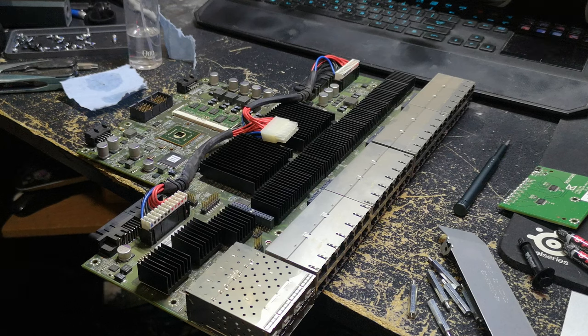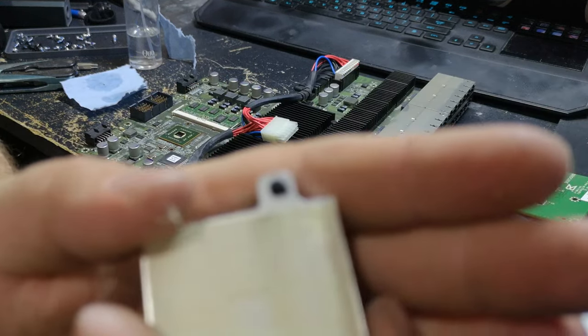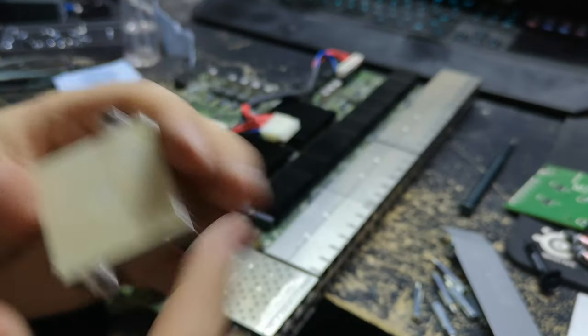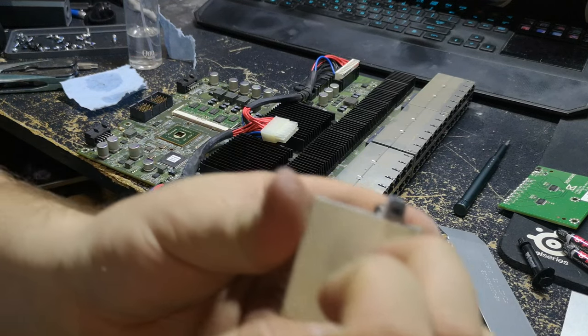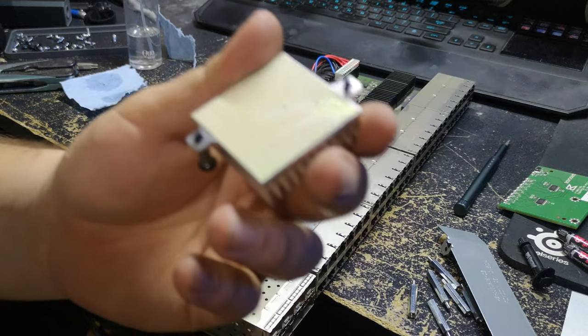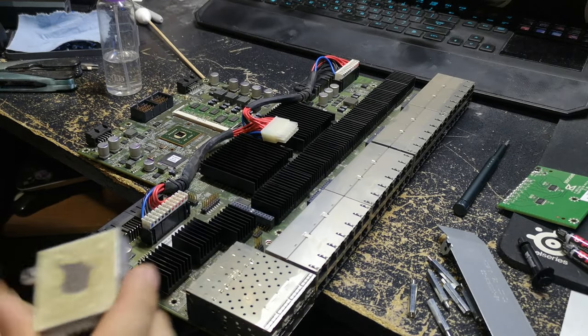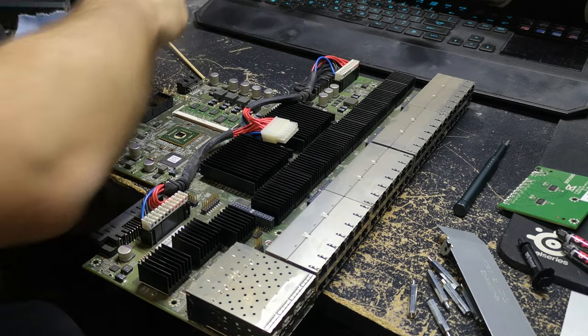MX4. Now you can see it's actually discolored the heatsink gold underneath. But yeah, I'm just going to pack a bunch of this under my fingernail. It's scraping off pretty easily. And then we'll swap it out for something better. Alright, so no point doing the whole chip, or the whole heatsink, but I've got the center section nice and clean. And this stuff really goes everywhere.